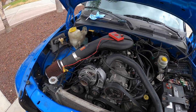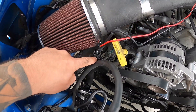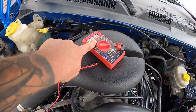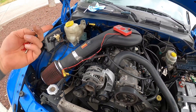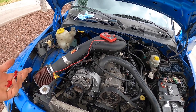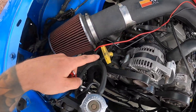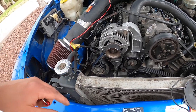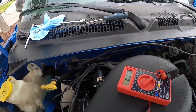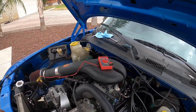Nothing. I hate to keep swapping parts but I think maybe something to do with the coil pack, because I took off the two wires that lead to the coil pack - we have no spark - and I get voltage going to the coil pack when I try cranking it. So it's trying to send a spark, which means all the other sensors should be sending the signal for spark but for some reason we're not getting it. We're coming down to the last little bit here - this coil pack may have died on us and maybe that's the culprit. I don't see any other reason. Might just be a dead coil pack - when I crank it we get voltage here.